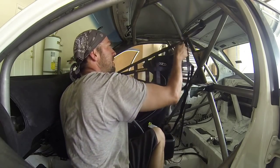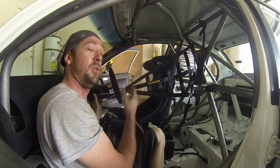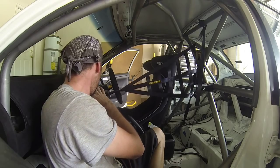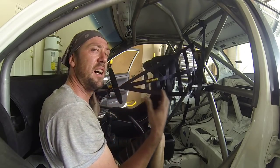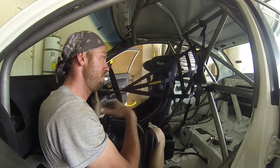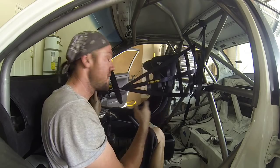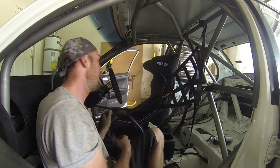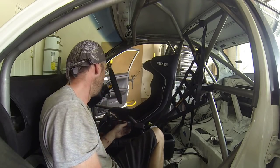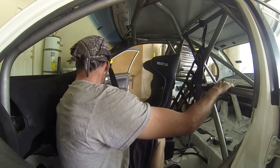We've got to find a spot for the front of it to reach, and there's not a whole lot of space here — not really anything you can technically mount it to, but behind the dash there is. According to the rule book for the class this car is racing in, everything on the dash needs to be kept in place unless you need to modify it to facilitate installation of certain components. Looking at the dash clock, that seems to be the perfect place to run the front mounting portion of the net, because right behind the dash there is a factory dash bar, and that'll be a great tying point for the front of this net.